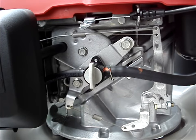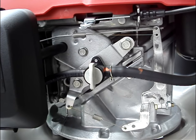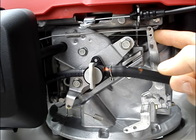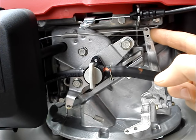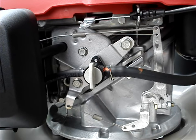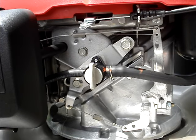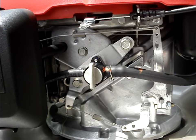There are also some complaints about the automatic choke starting to stick after some time. There are two springs, and this is the choke action. I'm thinking it's probably important to make sure those springs don't break or get gunked up with debris. The owner's manual also spends a lot of time on how to store the mower with gas — I'm thinking that if you don't follow those procedures, after some time the carburetor starts to get gunked up and stuck.